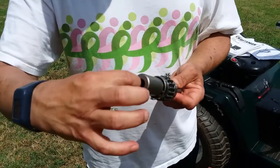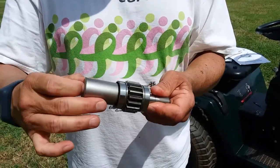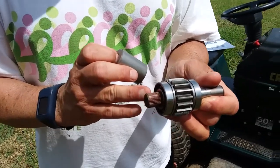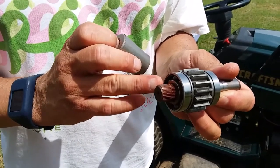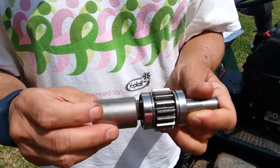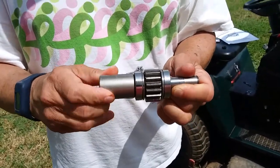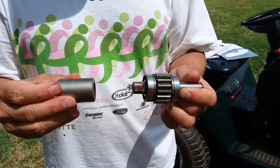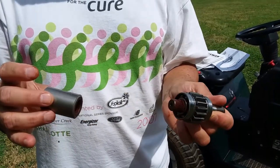When I first took it apart, I took my needle nose pliers and tried to move it, and I was like, well, gosh, it's not spinning there. But the deal is, once it breaks loose, who knows how long it ran that way before the splines actually wear down to where they slip. See this? That's your problem. So if you happen to push down, you can get to where there's still some good spline left, and you'll get a false indication that, oh, this isn't my problem. But in reality, if it's loose, you'll probably find that indeed it's stripped out.